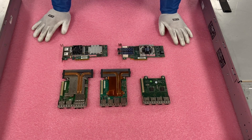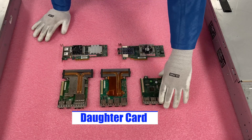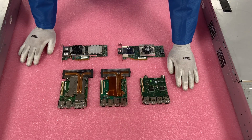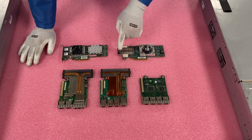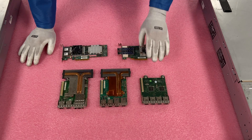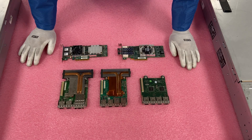I wanted to get a close-up to show you a better view. These are the daughter cards up here that have their own carved-out section, and these will be your PCIe versions. The daughter cards have four ports, while these PCIe cards are going to have two ports. There are some high-profile ones with four, but generally speaking you're getting dual ports with PCIe and four ports with your daughter card — which is one advantage.